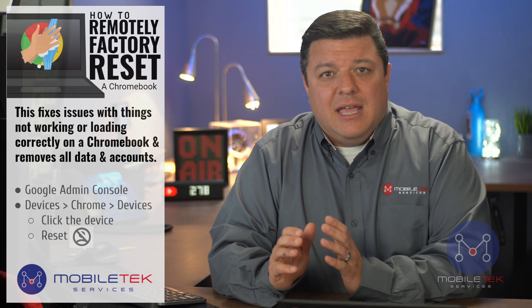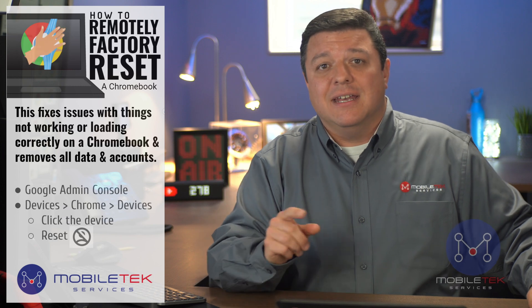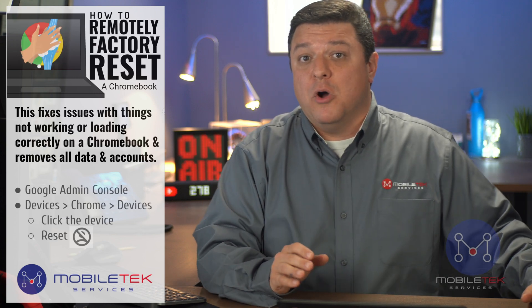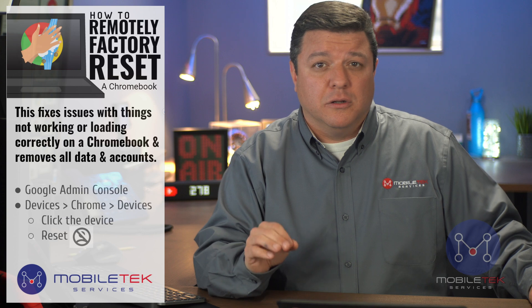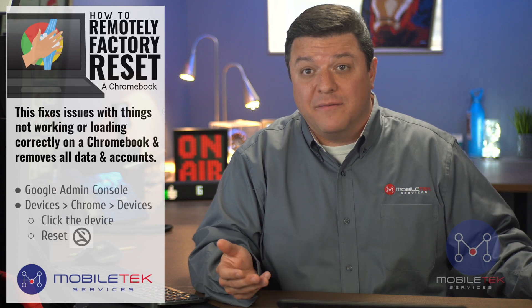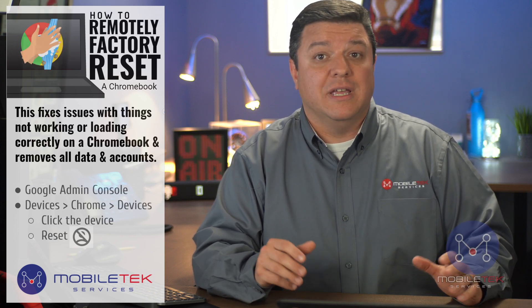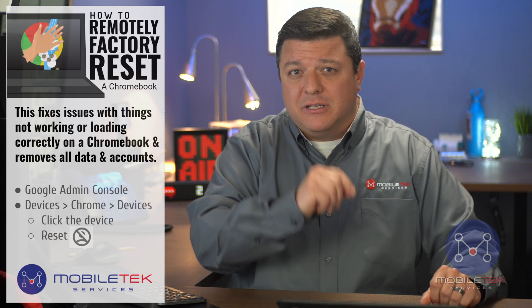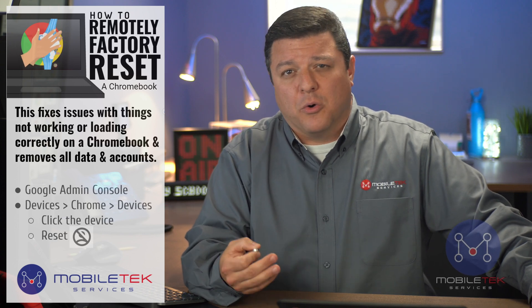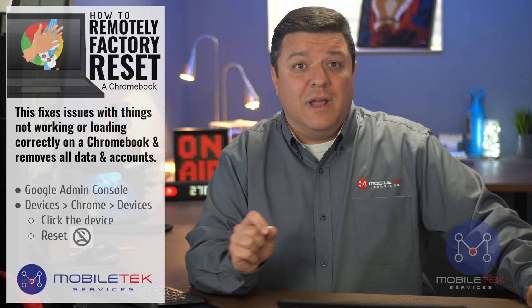Nothing is going to be reinstalled. This is a great way to clean up a Chromebook and make it a little bit faster right before testing season. The next is called Factory Reset. This one is a bit more involved as it resets Chrome OS back to its defaults and removes any local profiles and data. In addition, the user will be prompted to re-enter the Wi-Fi information for the device to reconnect to the internet and perform its automatic enterprise re-enrollment to your Google domain. I use this one when I'm trying to reinstall a testing app, or if I think an extension is corrupt or causing issues, as it forces the Chromebook to reinstall all the user extensions when they first log back in.